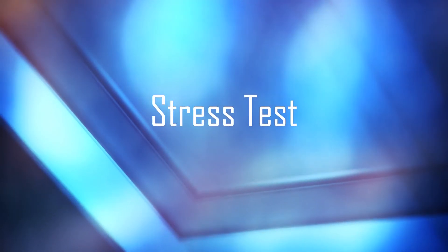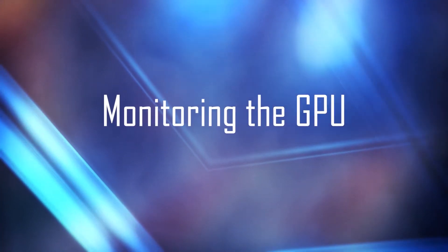Right now I have a great project that I'm working on — it's all 4K — so I started editing in Resolve, did the color correction in Resolve, and also used some GPU-heavy effects like lots of blurs and special effects. Depending on which version of Mac OS you're on, if you open Activity Monitor and go to the Window menu, you can open a GPU monitor — a small black persistent window that shows a bar graph over time of how much your GPU or GPUs are being used. When I didn't have the eGPU connected it only showed the Vega 48, but when I plugged it in it split into two vertical bars — the 48 on top and the 56 on the bottom — so I could see how much of each GPU was being used. I kept this window open and just went through my whole day keeping an eye on it.